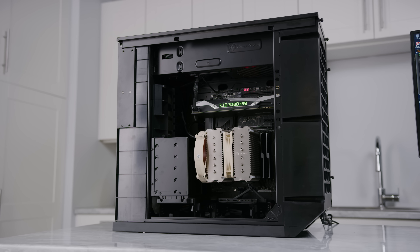Because of the filtering system design, nearly 40% of the space inside the case is taken up by the filter in the front and the buffer in the rear to prevent water from entering. It does limit your cooling options, but even with the relatively limited space, the MMO1 can still fit four dual-slot graphics cards and easily houses up to an SSI EEB dual-socket motherboard — if you're willing to limit storage expansion to two 3.5-inch drives. It's actually kind of amazing how much air these fans move through that HEPA filter.